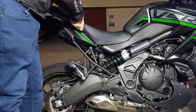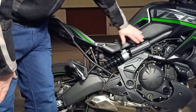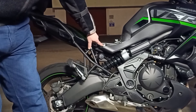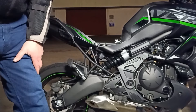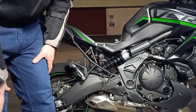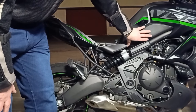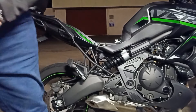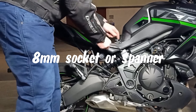First you've got to remove the seat. Once the seat is off, we have to remove this side plate here. It looks like there's a bolt holding it in and these might just be popping in. I can't find any information on this, so hopefully we just need to take this bolt out and it pops out. The airbox and where the sensor plug connects is just on the other side. We need an eight millimeter socket for this bolt.